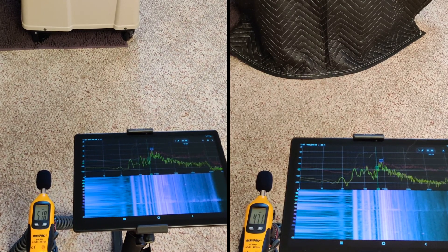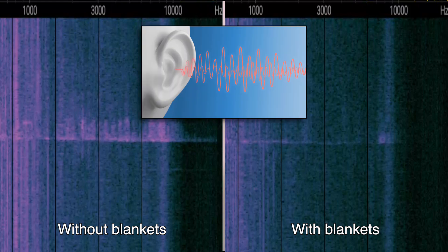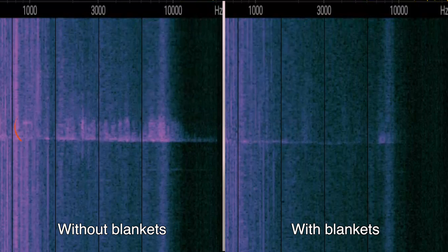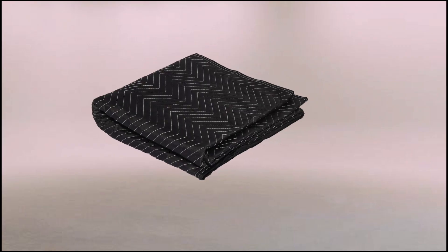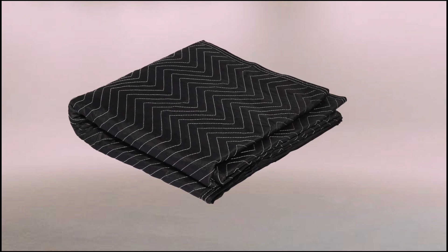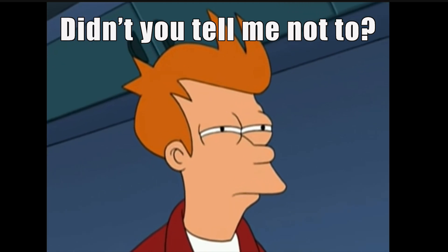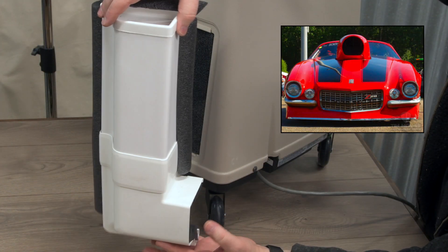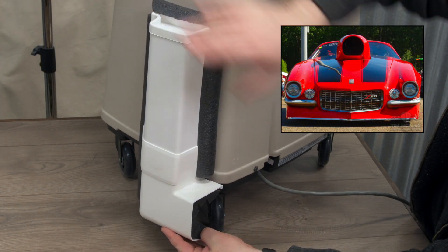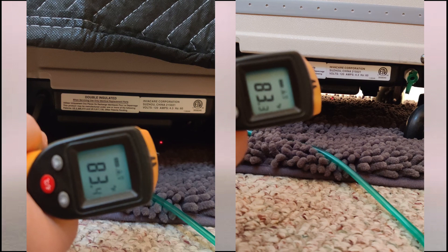The final trick not only reduces the decibel level of the noise, but it really changes the frequency profile of the noise that escapes from the cabinet. Certain frequencies are perceived as much louder than the decibel measure would indicate, so changing the profile of the sound can make a remarkable reduction in the annoyance factor of the machine. This solution uses thick moving blankets to wrap the machine, thereby reducing the sound that comes through the cabinet. But didn't you just tell me that covering the concentrator is a bad idea because it can block the intake vents? These snorkel air scoops solve that problem. They work like hood scoops on a race car, redirecting ample air for the machine without the side vents being blocked by the blankets. Since there are no exhaust ports anywhere but the bottom of the machine, the blankets don't cause overheating. The exhaust air is coming out the same temperature, whether the machine is wrapped or not.